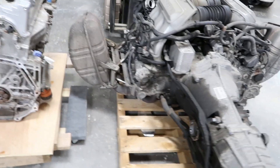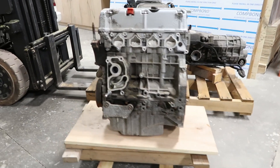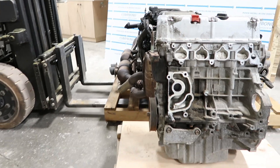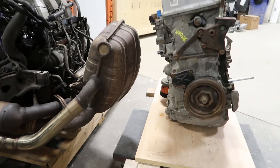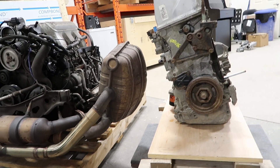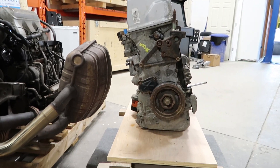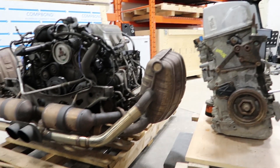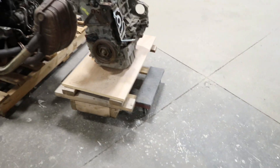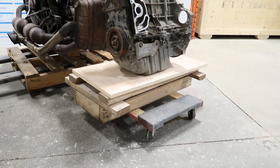You can see I've lined it up with the transmission and it's almost perfectly aligned. The K24 is technically not even as long as the Porsche engine, so the big thing will be fitting it in height-wise because this K24 engine is pretty tall. The other option would be the K20 engine, which is almost an inch shorter, but ideally I'd like to go with the K24 because more displacement equals more torque. Let's roll it underneath the Porsche and see how much room we have.